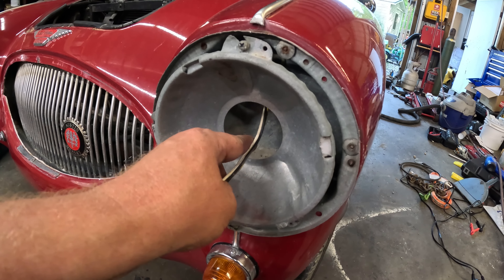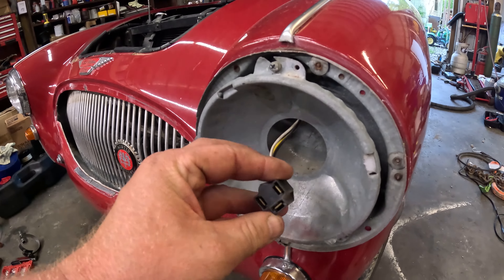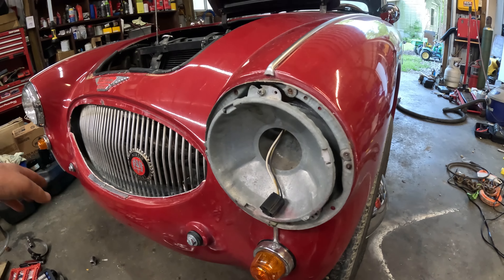I'm going to start following this wiring back and see what we've got. I may go ahead and climb up under the dash and see if we've got power coming off both sides of the headlight switch. I would assume the switch is good because the taillights are working. But depending on what kind of switch and contact setup it's got, more than likely we've got a break, or maybe this chassis has a fuse or relay in line for the headlights. I don't have any wiring diagrams for this car, so I'm going to have to hunt for it.